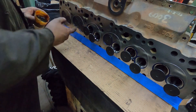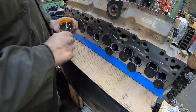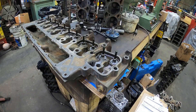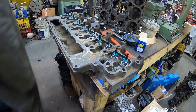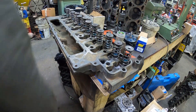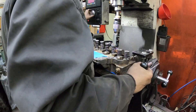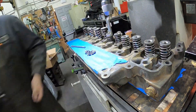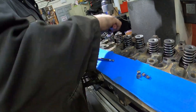I'm going to bang it into time-lapse now - I'll finish this off and then come back. Maybe I'll do one with you guys watching just so the video isn't too long. Just see me doing the rest of the valves there, getting them lubed up. One thing - I'm putting painter's tape on there just to protect the surface from getting scratched. Get a little WD-40 just so the seals slide on easier. I have this tool I made up for tapping them down. You don't have to tap them too hard, but you want to make sure you get them seated. Get the springs on and get the retainers on.